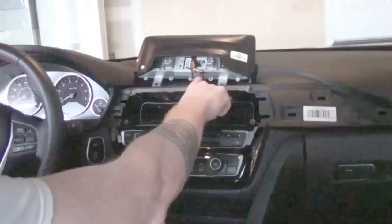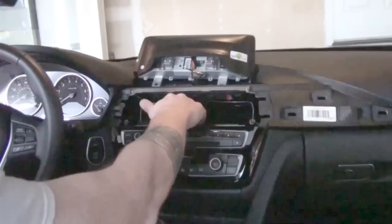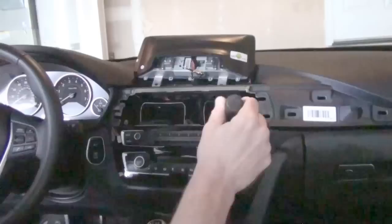The optical cable is connected and the GPS cable is connected. What we're also looking at is the data cable for the device, which needs to be routed back down for the CAN bus wiring back behind the dash and back behind your existing stereo unit, so all your controls and everything else work.